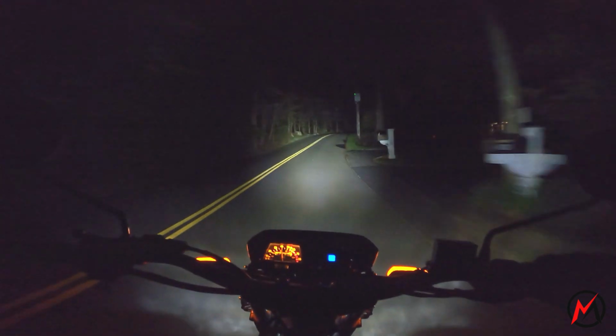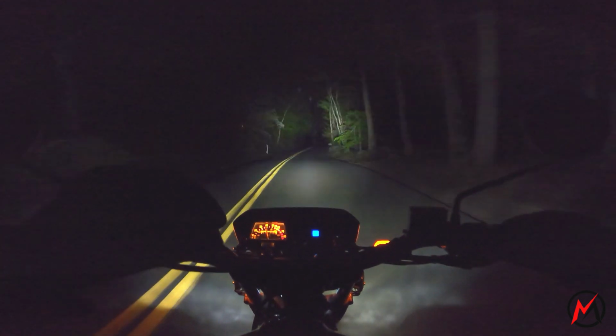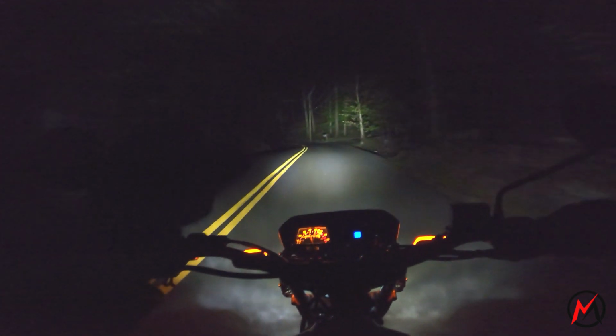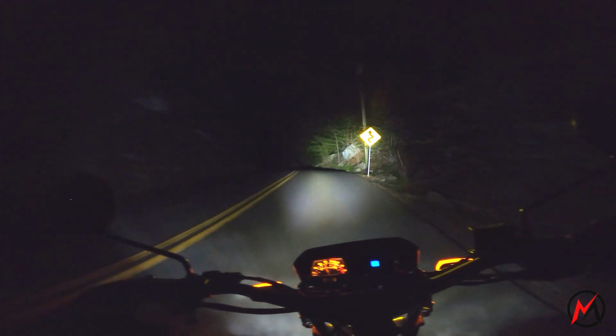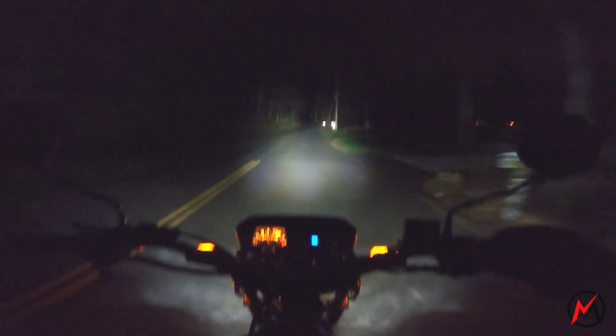I was a little bit skeptical because I know that this bracket's a little bit thicker, and I wasn't sure about that because I didn't want the bolt to sit farther out and have less thread grabbing where it's supposed to. But after I measured it, it's really only about 1.5 millimeters thicker, and it's just going to be a lot stronger, so I think it'll hold up better.